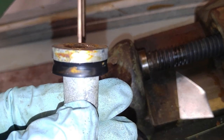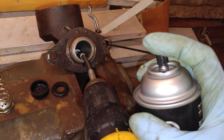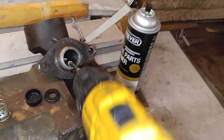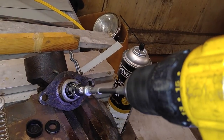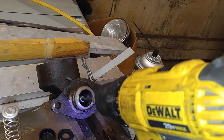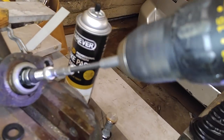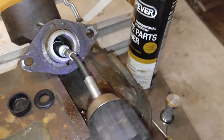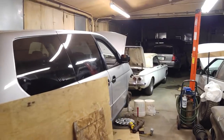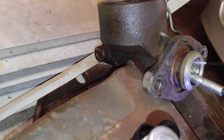This isn't focusing very well, but there's no nicks in this. It's amazing how good it looks even though there was rust in the bore. I'm going to spray a bit of brake clean in as lubricant and then hone it a little bit, see if I can clean it up. I know a rebuilt one is cheap, but I don't want to spend any money. Look what's pouring out of it — good juices!